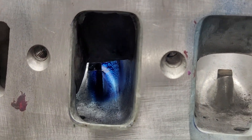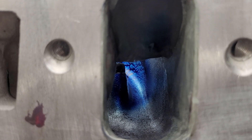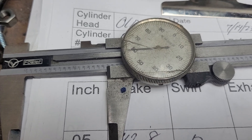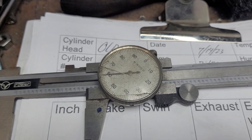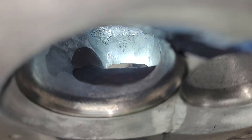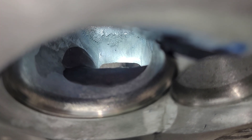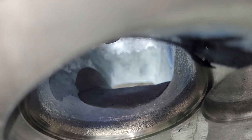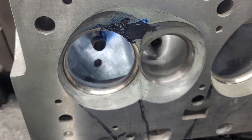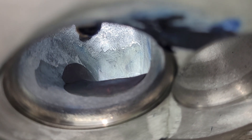When we look down its throat — that's the same 19 cc's worth of clay I've been using. The short side radius — let me measure how tall that is — okay, that's one point six six inches tall. I think we were about an inch and a quarter to start with, so I came up quite a bit. That's a lot of area to take up. Let me try something different so you can see it — yeah, that's a lot of clay on top of that short side radius.